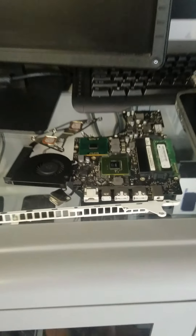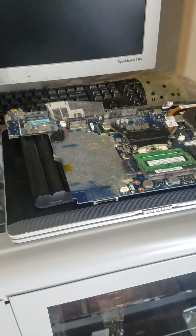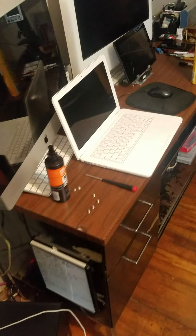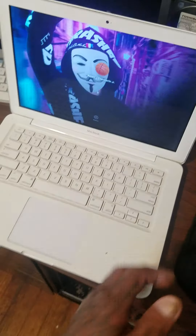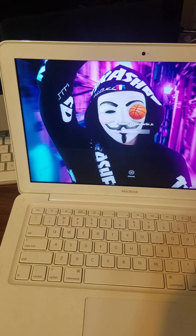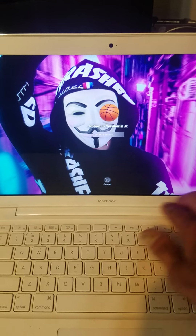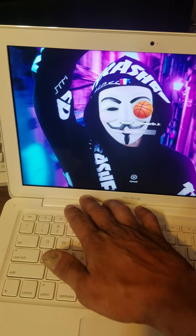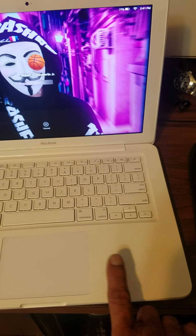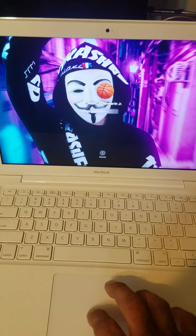Working on another MacBook too — got the motherboard over here. That's the MacBook down here, another one just like mine, a 1342. We're also working on this Dell laptop. I just got mine back together — this one's got a bad LVDS cable, and I've got that cable coming. That's why this is loose around the top. Later I'm gonna put some double-sided tape on it and get that back on, but I gotta change out the cable first. My wife had spilled Coca-Cola on it, so it wasn't working. I had to change out the whole top half and the trackpad, but we're working now again.